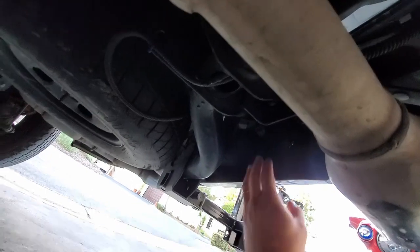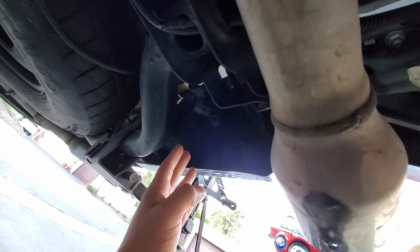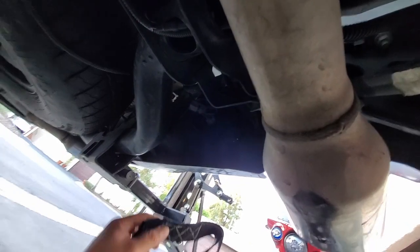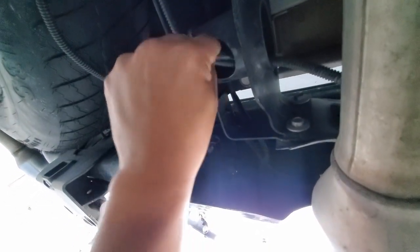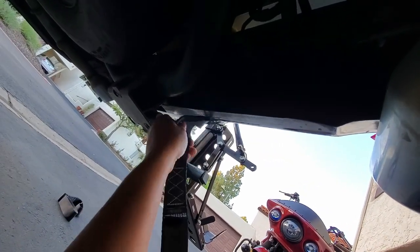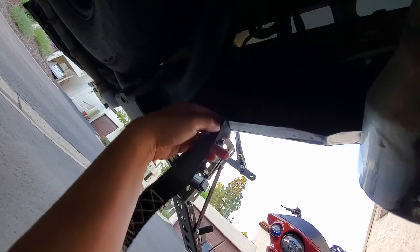You could strap this thing down to your bumper, but my concern was that it would potentially slide back and forth regardless of how tight you put the ratcheting strap. So with this soft strap I've got a couple of options — this open space here on the frame, and this hole where wires route through. To avoid getting up on those wires, I'm just going to go through here with my soft strap. One side is like a regular belt and the other side has a twist — you pull the normal end through the twist.